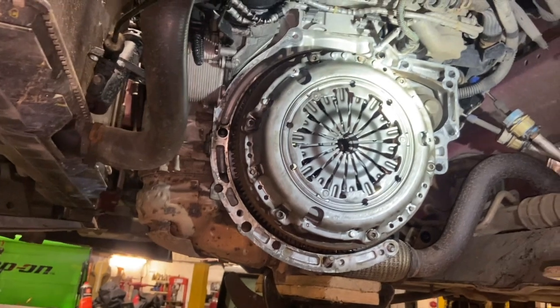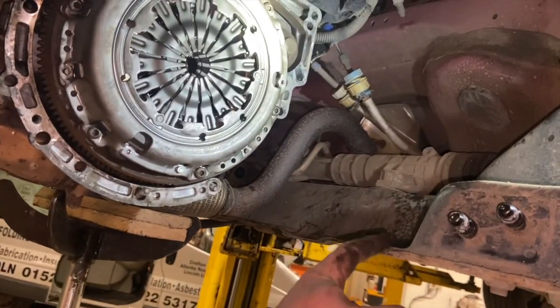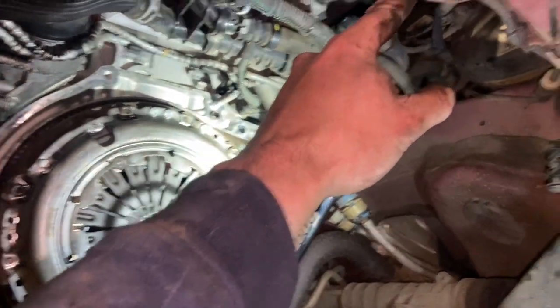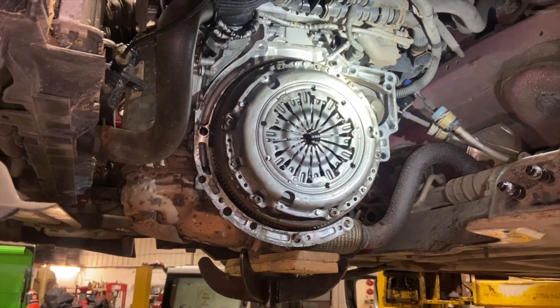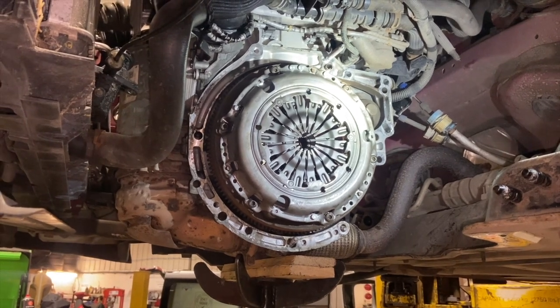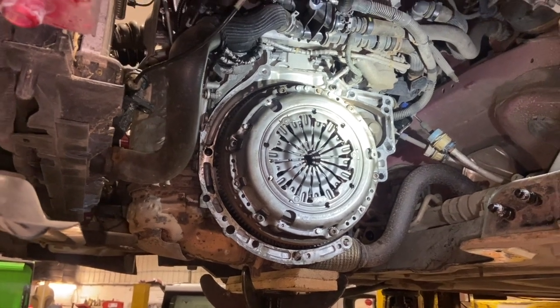Sometimes you want a few of you doing it, it just makes it a little bit easier. You have to lift it up around the back of the subframe here and guide it in over that stud at the top as well. Sometimes the top stud from the engine mount can be a little bit tight on here, so just watch that wire while you do it. But just work the gearbox in and then I'll run you through some of the next steps. I'll fly through the video on some of the bits. Obviously it's just building it back up as we've taken it apart, but I'll run you through all the correct quantities and some torque settings for the level plugs, etc.